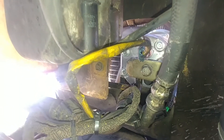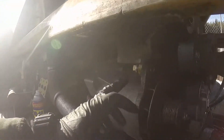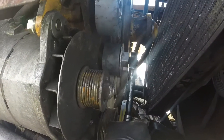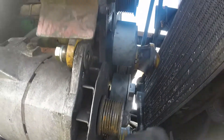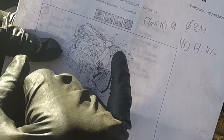Connect the AC lines — the high-pressure line and the low-pressure line — and connect the clutch wire. I also put a second bolt on the alternator; there are no adjustments on this alternator, just two bolts holding it. Found the right size, screwed that bolt in, and added a lock nut and washer. Now we need to get the new belt installed — pull the tensioner down and we can start routing the belt.